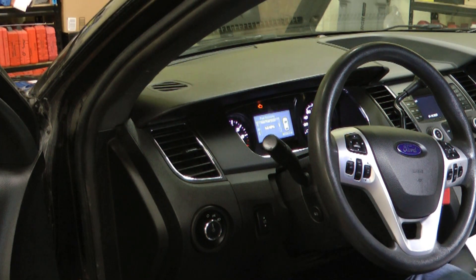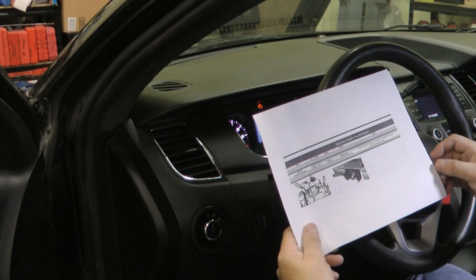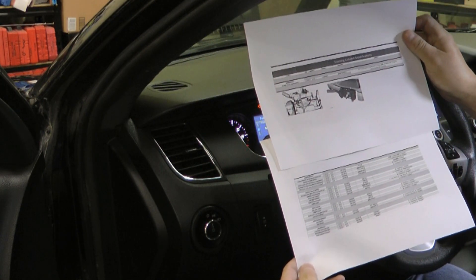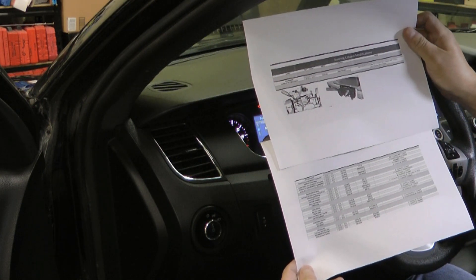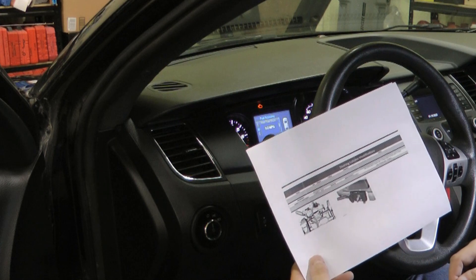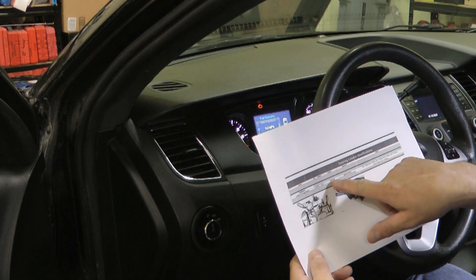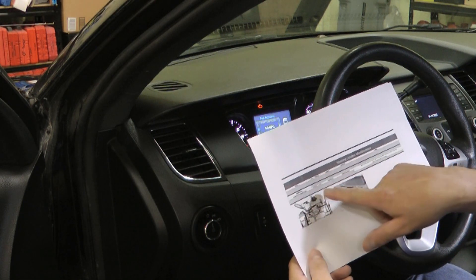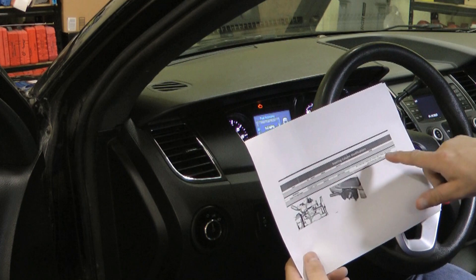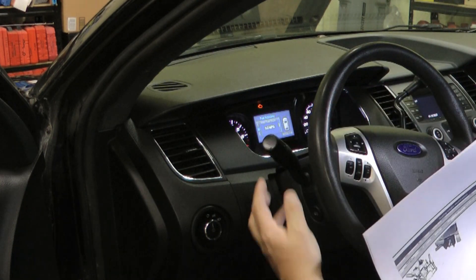I brought special guest Panzer Platform to show us how to do this. He often prints stuff out so you can see — these are different programming things you can do with FORScan. I've done other videos on FORScan so I won't go into all the details, but basically 724-01-01 is the parameter for the number of turn signal flashes, and you can set it for one through seven. I'm going to shoot for five — mine is currently set to three.